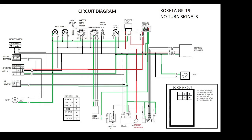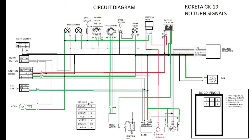One of the first things I did with this diagram was identify where the ground is, where battery power is, and other sources of power. The green wires indicate your ground plane — how everything ties together from a grounding perspective. Anywhere you see a black dot, that means there's an actual wire connection at that point. If wires cross without a dot, they're simply passing by one another and not electrically connected.